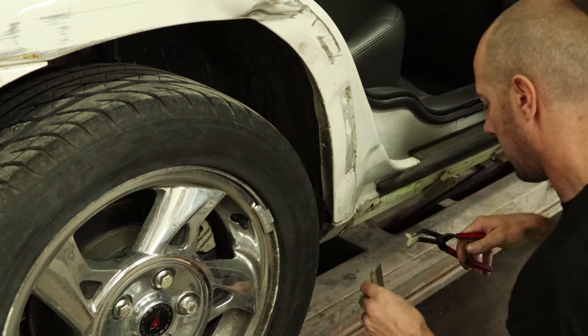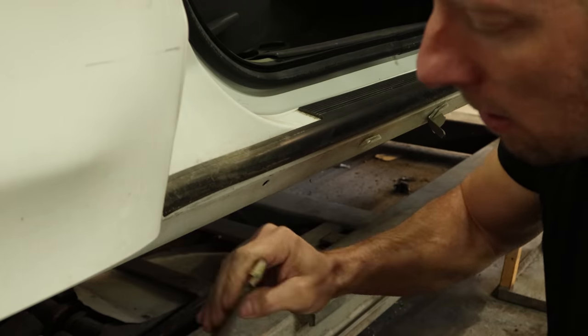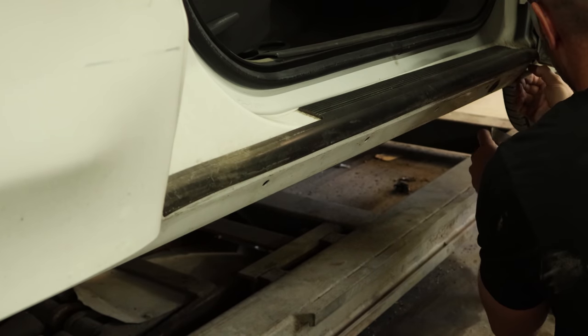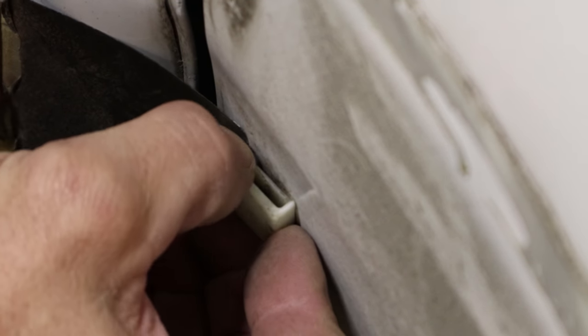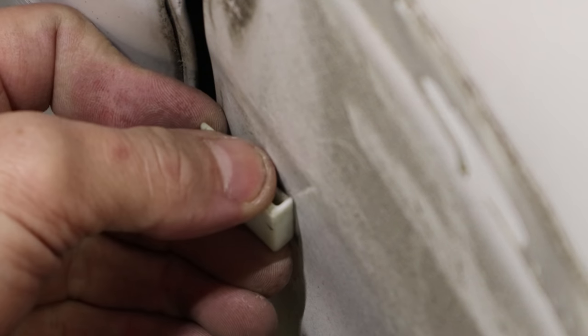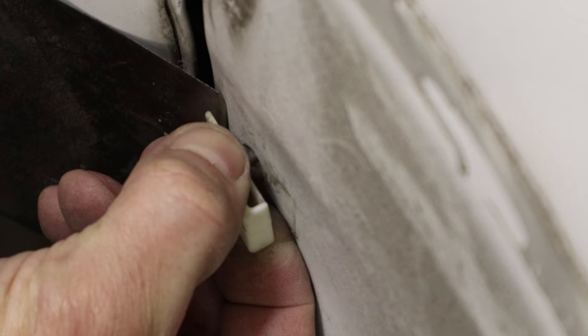Get the two-sided tape off the back and get the molding out of the way. Now you can remove the rest of the clips across the bottom. Here's a close-up — just push the tabs in, hold a little tension out on it, not too much. Sometimes they fight you and clip back in. Takes a little patience to save them.